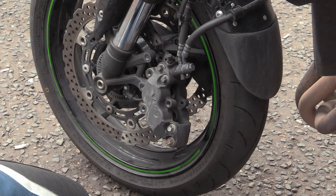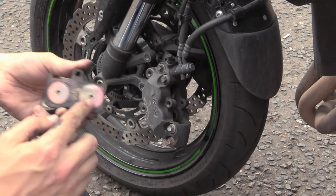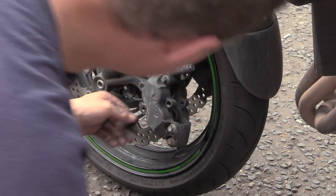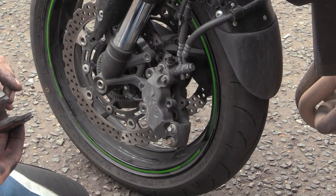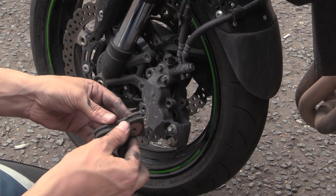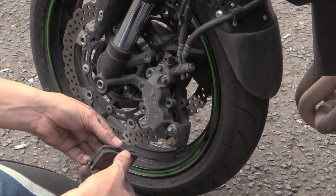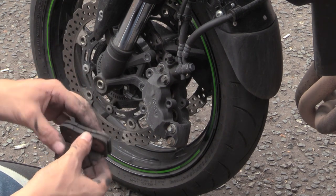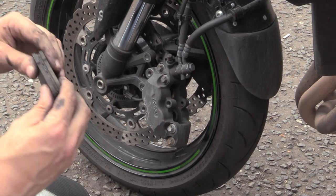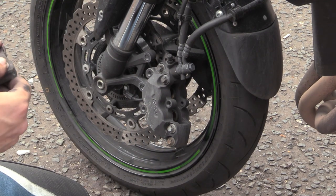So, pads, no copper grease on the back, it's just dirt, but weirdly enough, copper pads. Are these pistons? Yeah, these pistons are tiny, actually, they're hollow. I mean, really thin-walled. But the pad material doesn't look that bad. They've been wearing almost evenly. New pads, Isaac, mate, that's what we need, look. You can see the wear lines there. She has been wearing ever so slightly misaligned.